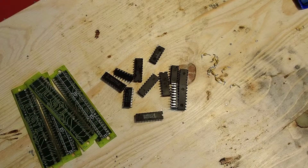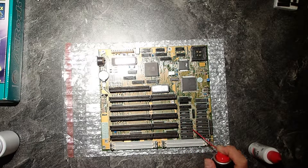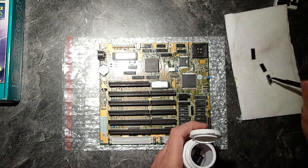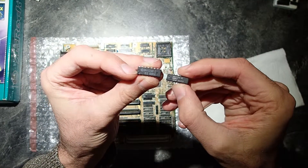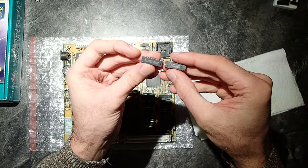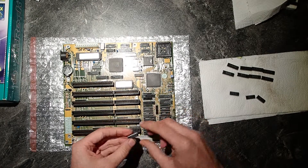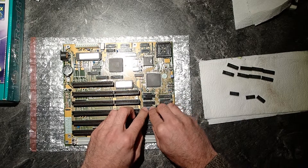This is the result of our work so far. Now let's do the fun part and put everything into the mainboard. I'll put some contact cleaner into the DIP sockets, because I don't even know how long they haven't been used before. I also put all the desoldered chips into isopropanol to clean them from flux and dirt. During the desoldering I realized that despite all the SIM modules being from the same set, not all of the chips are made by the same manufacturer — but I don't think this will be a problem. When you push the chips into the sockets, always think about the polarity. There is a mark on every chip showing you which direction it has to go. If you turn it the wrong way, they will probably burn.